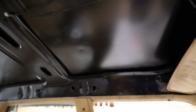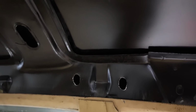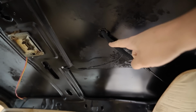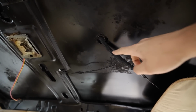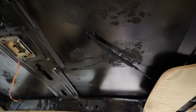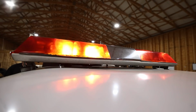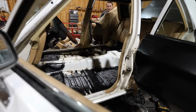So over here, we've got the mounting for the light bar itself. I just drilled 2 holes. It's a bolt and a nut with a lock washer to keep it from falling off. Then right here, that's what that plug is. I've got to go back through and just make sure it's watertight, but our power and our ground comes through here. It grounds right over there. Our power wire goes down into our switch, and it does this. Yeah, now that is awesome. Taking care of important stuff.